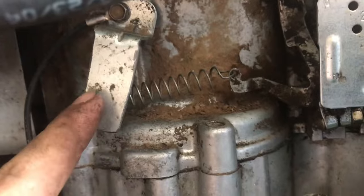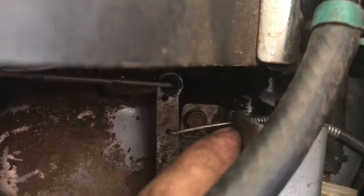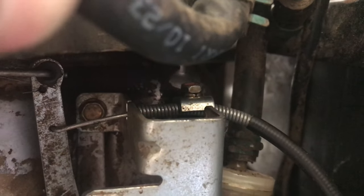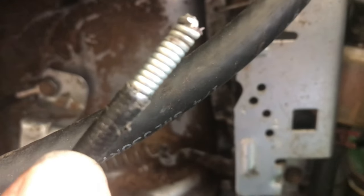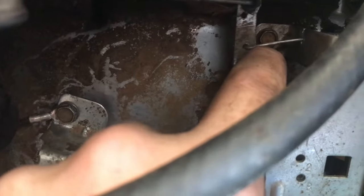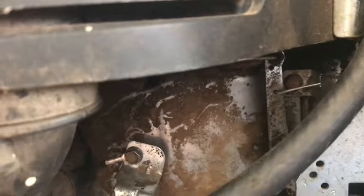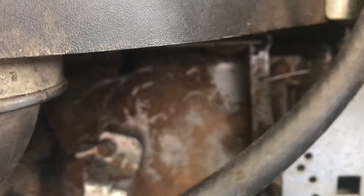I got this set up here, so this spring will reset my throttle. And up here, I got my throttle. So I drilled a hole in it right there and hooked my cable up. You see I got that slot going through there. And back over there is where I welded up that clamp to clamp on my cable. And here is the end of it. As you see, I need to cut the sheathing off the cable a little bit and make that a little longer so I can hook it to my gas pedal on the other side. But as you see, it will go back and it'll reset with my gas pedal, because I got a big spring on it too. So I bet that'll work really good. Let me hook this other side up to the gas pedal and we will give it a try.